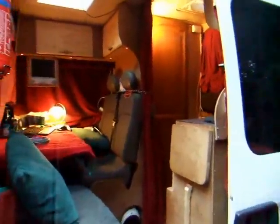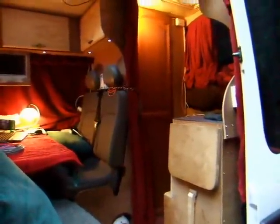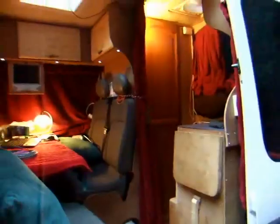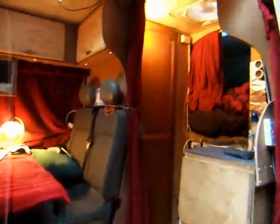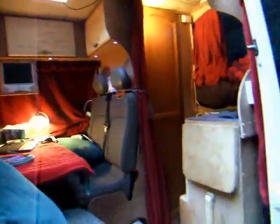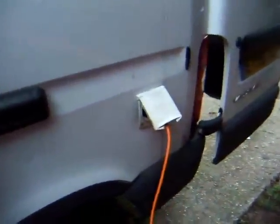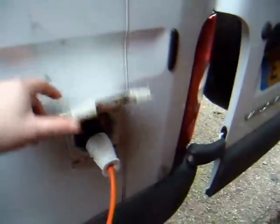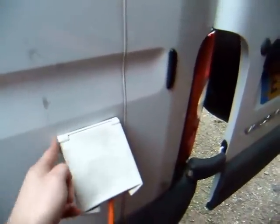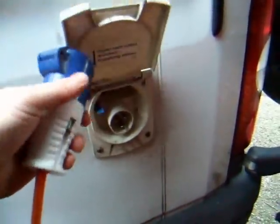So here we are outside the van for the second little bit of the 240 volt electrics, having seen the wiring diagram just now. You can see everything in there is working — all working off 240 volt or the inverter, nothing off the battery directly at the moment. So here's the hookup point. Quite easy to fit — you just cut a hole in the body, put masking tape round to the size of your hookup unit. I'll just take that out so you can have a look at it. They're very standard sort of accessories; get them from any caravan shop.